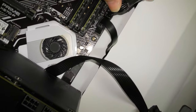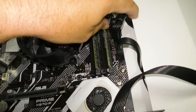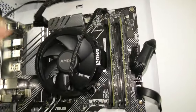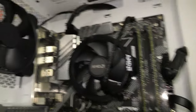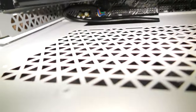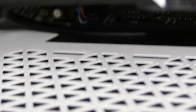They plugged the front panel USB 3 connector and the power connector up, but look how much stress those connectors are under because they've been hidden — there are big fat wires pushing on them really hard. This is a CPU power connector, so why there are two 8-pin CPU power connectors I have no clue. This is the kind of nonsense I deal with whenever people bring me computers they've patched up on their own. At least they got the audio front panel plugged up.